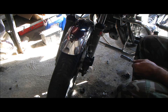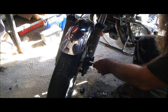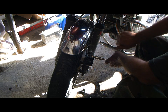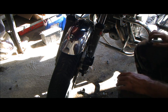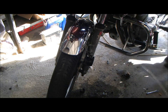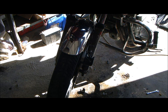Well, I got it. I know where it is, and I do what the manual says. I just can't get it to pump up. But I had a clutch before I turned around and started bleeding it. I should have left it alone. I told you to use a vacuum bleeder. I don't have one though. What do you do? Vacuum bleed? You just put it on the bleeder, and then suck it through. I'll show you. I bent my 5/16 wrench.